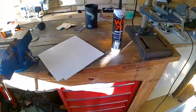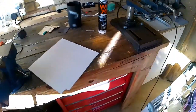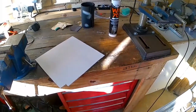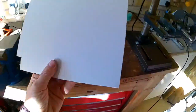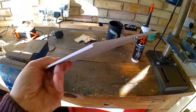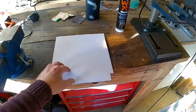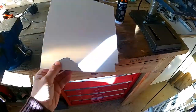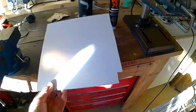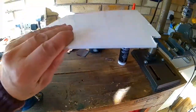For anybody interested regarding the big hole in the van which was a vent for the gas fridge — to fill that big hole I used this plastic sheet. It's quite thick and very shiny on one side. This is used in wet rooms and shower cubicles. It's very easy to cut and very easy to mould with a heat gun. I got a few sheets of it from my father. It's shiny on one side and matte on the other.